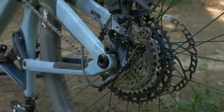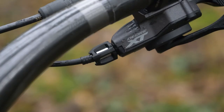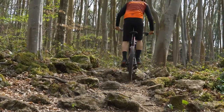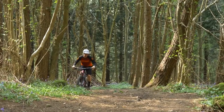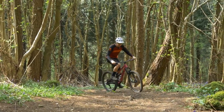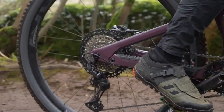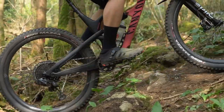There are some great ways you can avoid a gear cable snapping. Firstly, regularly check areas of wear and tear down near the mech and up near where the cable enters and exits the shifter, to make sure there are no signs of fraying, as these are places where there are high levels of friction and snapping is most likely to happen. Also, keep an eye on the actual way your shifting feels. Does it feel grindy and crunchy? If it does, there's a high chance that the cable itself is rusty or the inner and outer are contaminated — mud and water have gotten in there and it's no longer running smoothly. If that's the case, it's probably time to replace them both. Try to avoid shifting under load when you're riding, as this puts a lot of extra stress on the cable, and crunching gears don't sound good either.